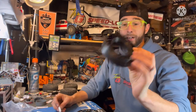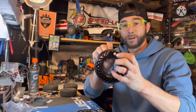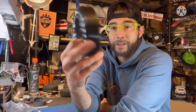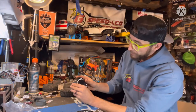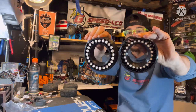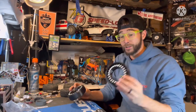In the rear, I'm going to take the larger diameter tuning rod and put it right here in the middle, all the way around — just like this. That's the pattern set up for the rear. This is just going to make it a little more overall stiff in the rear compared to the front. And again, these tuning rods are going to help out more with that side hill performance as well.